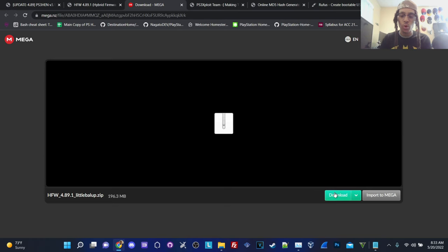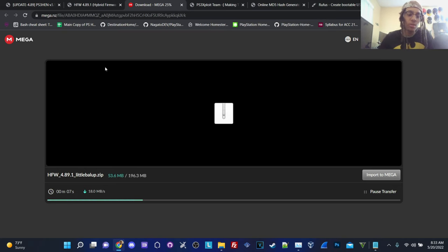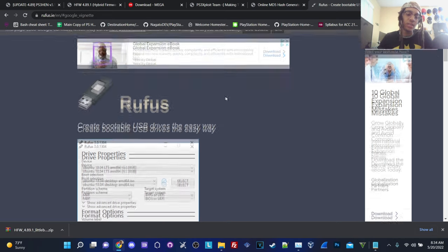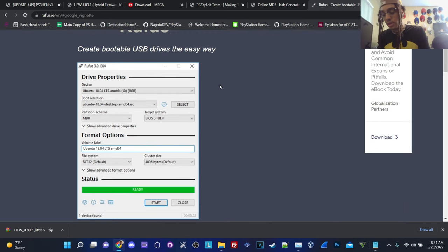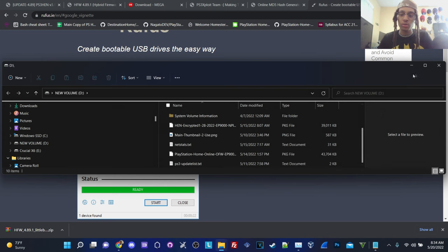Next, what we're going to do is go to our PlayStation 3 download on Mega — just hit allow. You can use MediaFire or anything like that, but I'm using Mega since that's a file cloud solution I'm used to. Once that is done, the next step is to unzip this file. We're also going to be putting in our USB drive so we can format it to FAT32, since that's how we'll be updating our system on a PlayStation 3. And last but not least, we'll check the online MD5 hash checker.